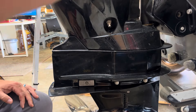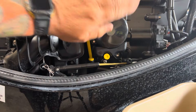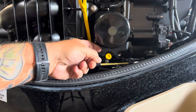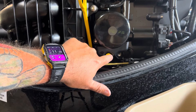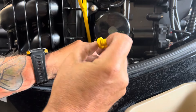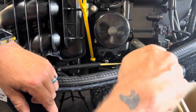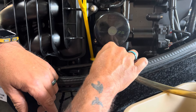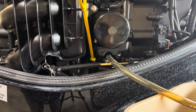Let's go up here and do the oil filter. Up here at the top you've got your oil filter, your dipstick, and there's a drain plug right here. This is a little catch pan — so when you're taking your oil filter off, whatever oil comes out is going to go inside that catch pan. Then we're going to drain it out with that same tube we used on the crankcase. So let's get this little plug off and set it to the side. We're going to take our little five-eighths piece of tubing — I don't expect a whole lot to come out of that, maybe what's inside the oil filter.